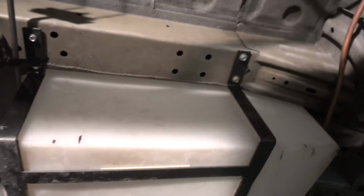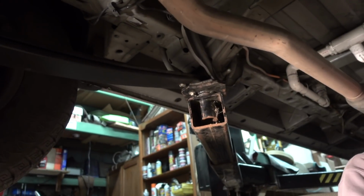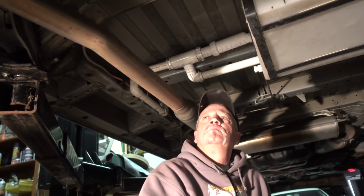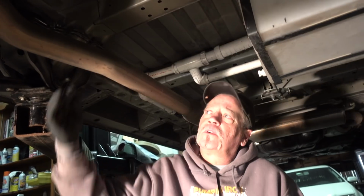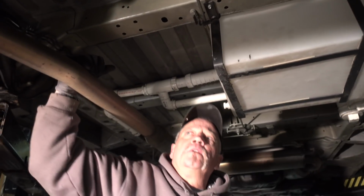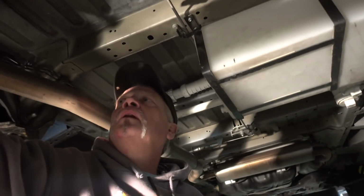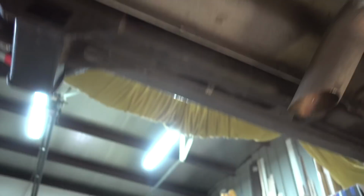This is where the water will escape the holding tank of the gray water, and now we need to figure out where to mount the actual drainage area, the access point. And the idea is back over the axle, because otherwise we have to cross right on top of the exhaust, which will melt the pipe, or the hose, whichever we use. This will give protection from the road, the axle itself. And we got a good shot to the back where we can mount the valve.